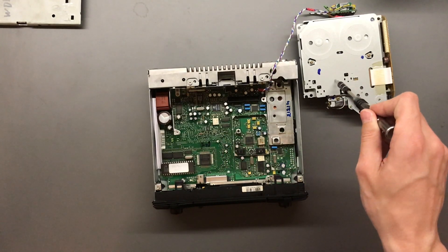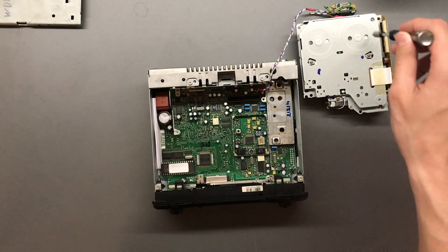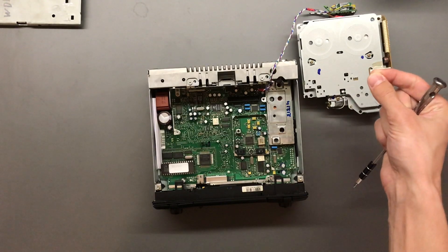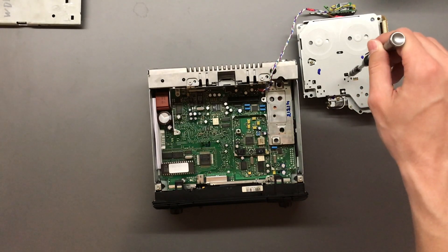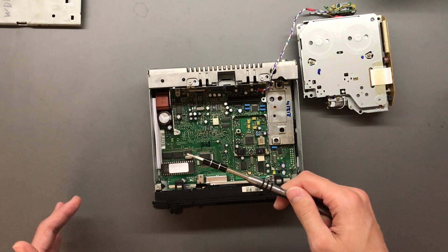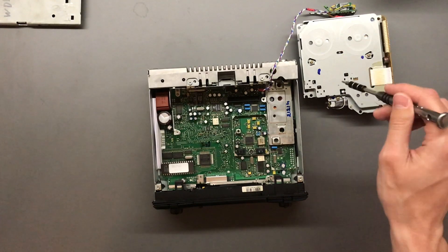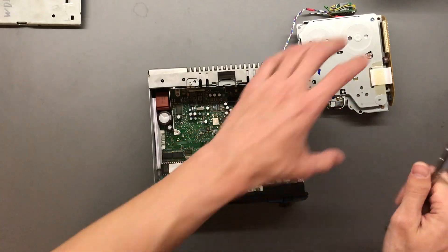The one issue this mod has: although there's a lot of gearing from the main motor to the main spindles, there's a belt that runs quite long. It's fine now and still has a lot of torque — I actually tried to stop the spindles and it's still quite strong. But once the belt dies, the CPU will notice the tape's not spinning, show an error on the screen, and go back to radio — so you won't be able to use the Bluetooth. That said, this should last at least 10 years even for future generations. I'm going to put in a tape that has no tape on it, just to prevent the mechanism from rattling.